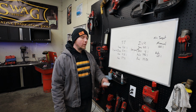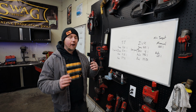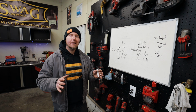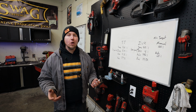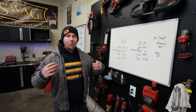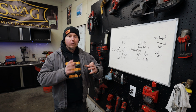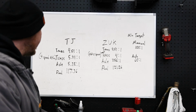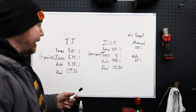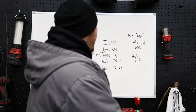And when you can crawl slow like this, it's great in snow because you can slowly let out and your tires don't just dig. Because sometimes, depending on the type of snow you're in, if it's really deep fluffy, you're going to want to dig every time you start to give a little bit of throttle, and then that torque converter has that delay before it starts to turn the tires. This is a really nice way to get around that. It was amazing. Honestly, it drove like a dream on big obstacles, small obstacles, everything.